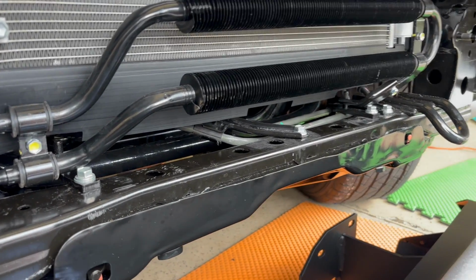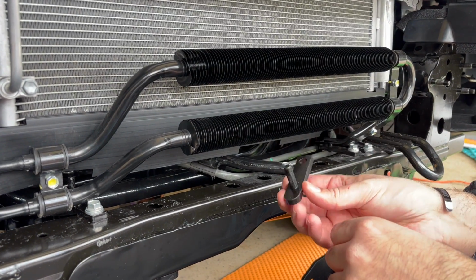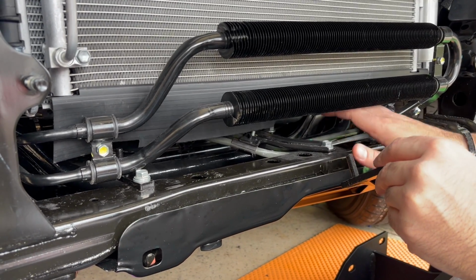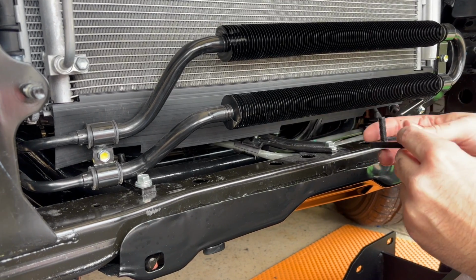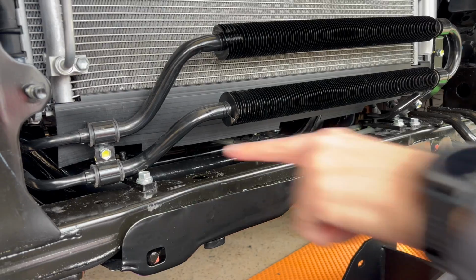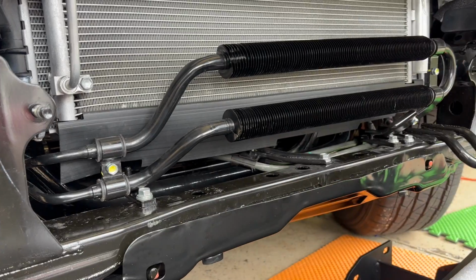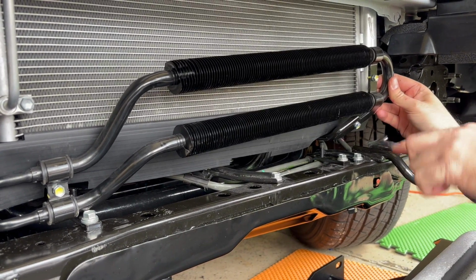Okay guys, so like I was mentioning, you'll get this bracket. Put it this way, with the screw going backwards, and don't worry, this radiator bar, the rubber has a lot of space. You're not going to crush it with anything. Put this underneath, use the screws we removed to do this. Obviously you will not be able to do it with a socket, so you have to use a wrench and tighten it, right? So it's tightened. You'll do the same thing with this one, but before I put this in, I'm just tightening this.